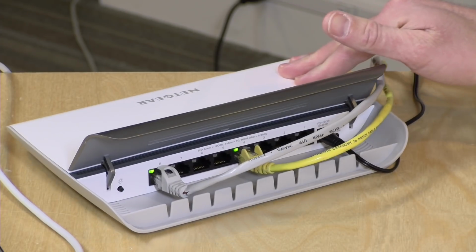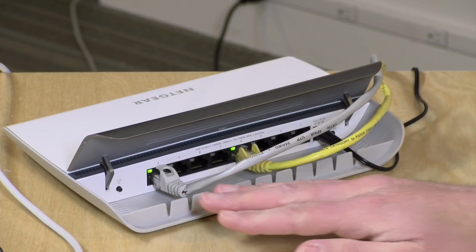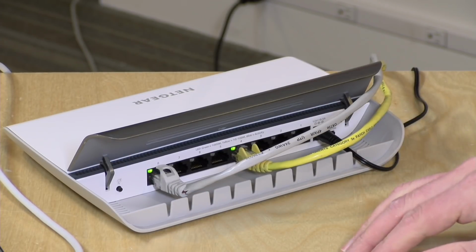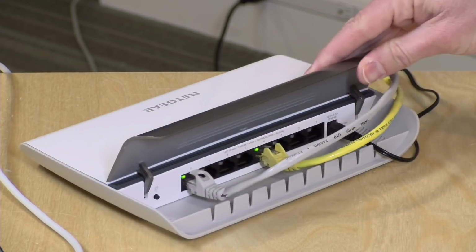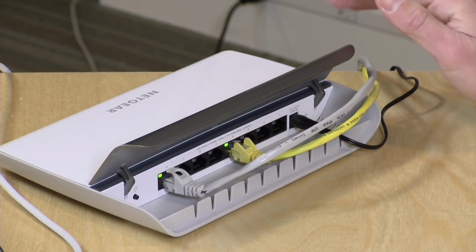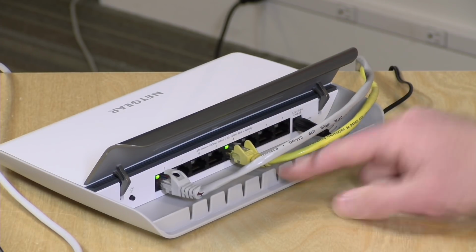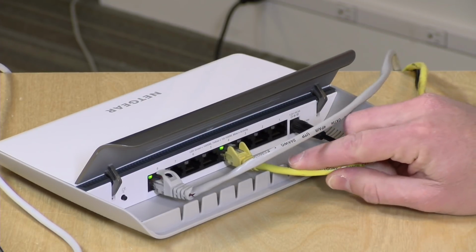And this switch is capable of handling 16 gigabits per second in total, but each port is going to be limited to 1 gigabit per second up and 1 gigabit per second down. So you won't get 16 gigabits on one port, but each port will operate at its advertised speed. But I'm really not going to be able to recommend this one because of the cable management system. It certainly performs okay, but you can get other switches at the same price that also perform the same.